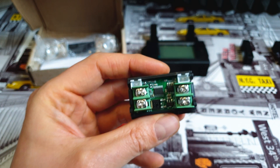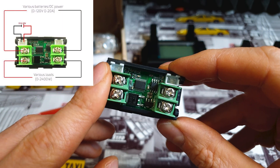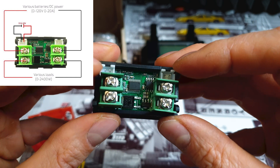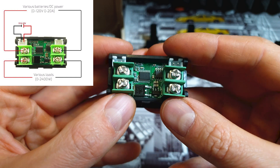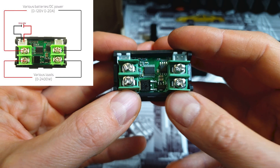I have to check the manuals to see which is which. Looks like connectors on the left are for red wires — so plus — and on the right we've got connectors for the ground, so for the black cable. Front connectors you have to connect to your charger, and the rear ones you have to connect to your scooter — so that will be the power voltage output.